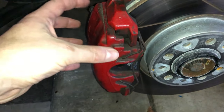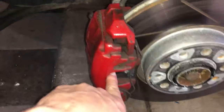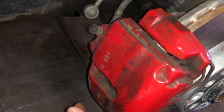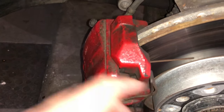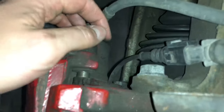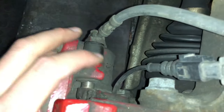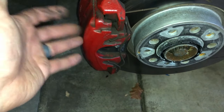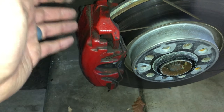The first thing we're going to do is remove the caliper from the disc because I want to get the brake pads off so I don't get paint on them, and it'll make it a lot easier to get paint into all the little crevices around the brake caliper. I'm going to take the brake caliper off, take the brake pads off, take the locking clip off. To do that, you'll see there's a bolt right here and a bolt down there — those two bolts are what need to come off to slide the whole caliper assembly off. Once we get it off, I'll prop it up on a bucket so there isn't any stress on the brake line.